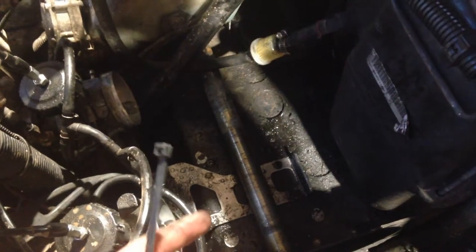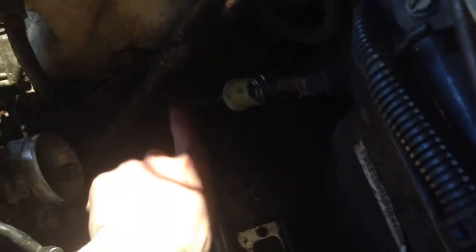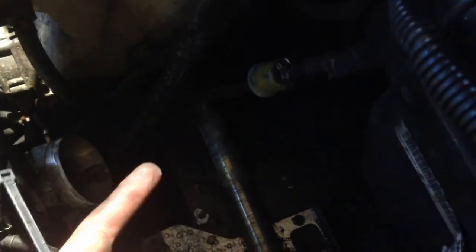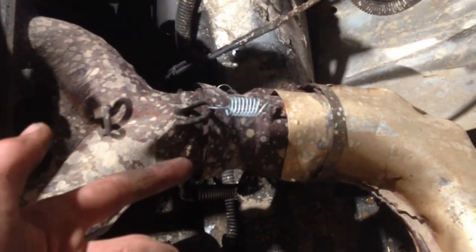For this sled it's about the same hole size as factory, so it'll stop the snow. Now this shaft always spins because it's coming off your secondary clutch, going over to your brake then to the track. Notice the fuel hose — see how it's touching there? They like to do that, so you've got to zip-tie them up. There are some lines here you can zip-tie too, under the air box. Those like to rub all the way through and then it starts leaking fuel everywhere, so just zip-tie them so they're not touching.